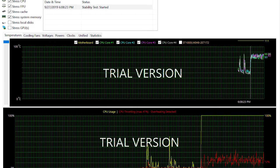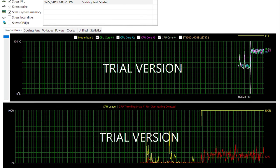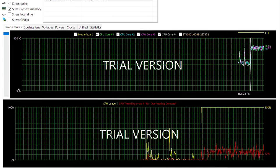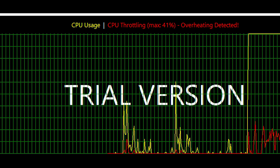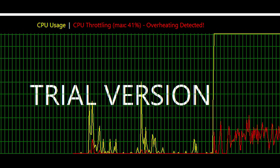The synthetic test showed me that the Magnus CPU idles between 45 to 50 degrees Celsius. When you put the CPU and GPU under load, the CPU will rise to a maximum of 87 degrees Celsius. That's hot, but not too hot — it's not hitting 99 degrees like some computers do. The main issue is that when this computer hits 87 Celsius, it will begin to thermal throttle, up to a maximum of 41%. When your CPU thermal throttles, it has to slow down, which means your videos may not render as fast.